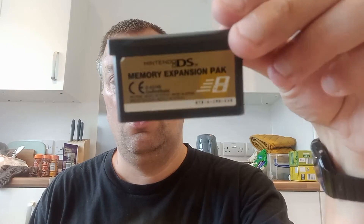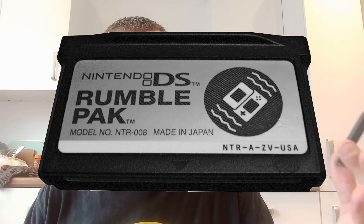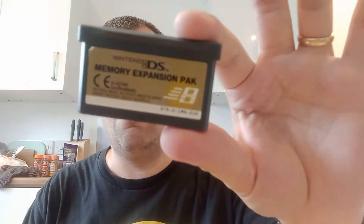If you bought the DS browser back in the day, you'd get a little cartridge — your web browser — which you'd pop into the DS, and then you'd pop this into slot two. The DS itself only has 4 meg of video RAM, which isn't enough to browse the web, so you need to expand the memory using this memory expansion pack. It's part of what they call the DS option packs — there was a rumble option pack too — and this one has 8 meg of RAM.